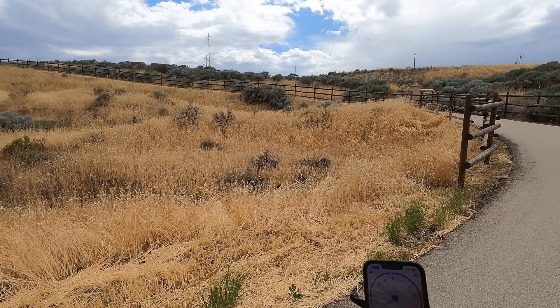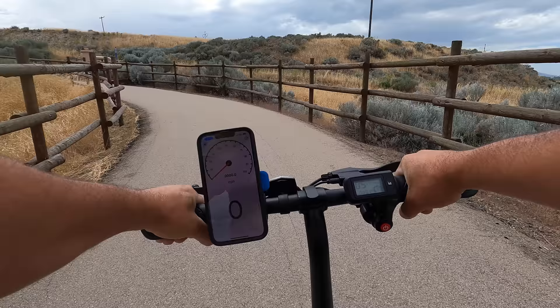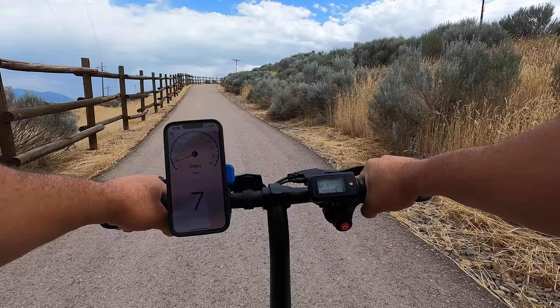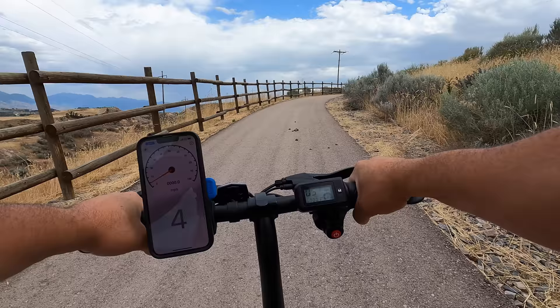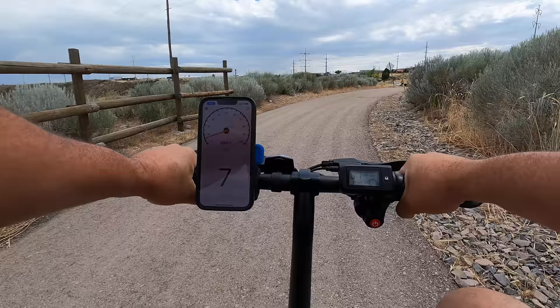There's no torque rating for the C3, but it's claimed to climb up to a 50% grade hill. This test is a 6 to 8% grade, about half a block long. Starting to climb right off the bat on a full charge. Here's where it starts to climb — just straight throttle, no pedaling. Down to six miles per hour, and at the steepest part, maybe nine to 10%, it's down to four. Had to pedal a little bit to help it out — back up to five. It honestly has better climbing power than I thought for something this small. 185-pound rider on a 10% grade hill — that's pretty impressive.